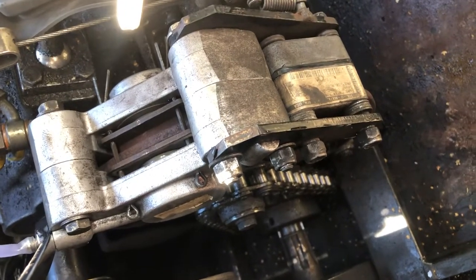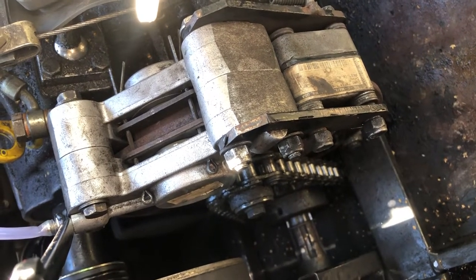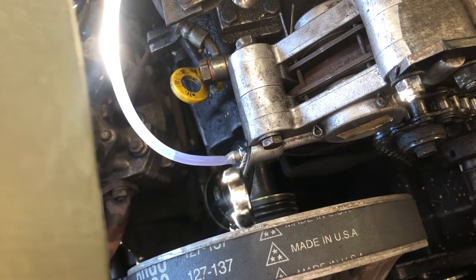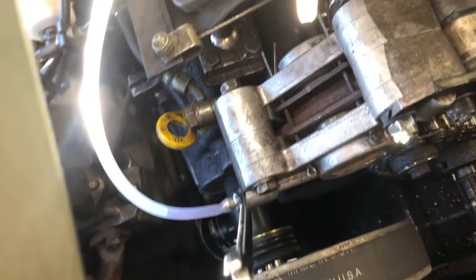Make sure you lubricate the seals with a little bit of brake fluid — DOT5 — as you do it. I've used this little device here, just an old spray bottle. Get a lighter, melt the top, push it onto the nipple, and then just keep pumping the handle back and forth. It's a great method for removing the air from the caliper — works an absolute treat.